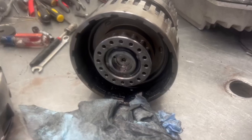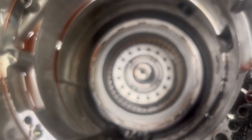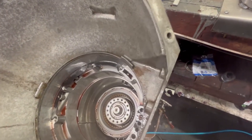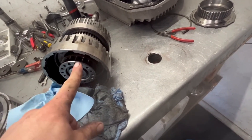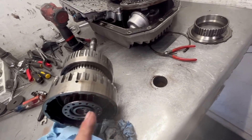One other thing I just noticed: this is the end of the input shaft out there - it's kind of galled up. It's been rubbing up on the end of the main shaft, and that main shaft is all tore up where they touch. They're not supposed to touch. So we have a clearance issue there. I wouldn't be surprised if that's an aftermarket main shaft - sometimes they're a little bit close and you need to trim them. We'll have to do a stack-up check and look at where the clearances are. In the extreme case it could actually push the input shaft up far enough to get a sealing ring off the forward clutch sealing surface, and if that happened that would explain this complete meltdown - because if you lose those sealing ring locations, if it's pushing up the whole input shaft and the sealing ring comes off its sealing surface, you're going to lose all hydraulic pressure and the clutch will fail. Something of interesting note right there.